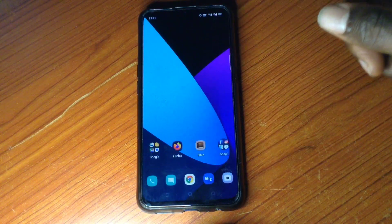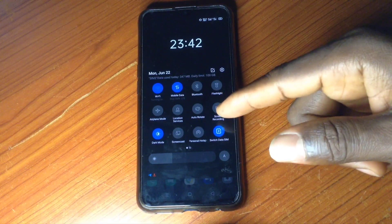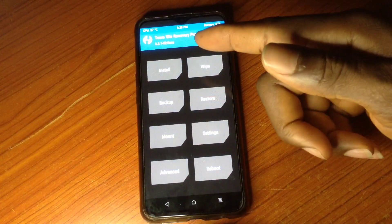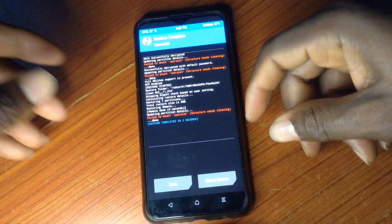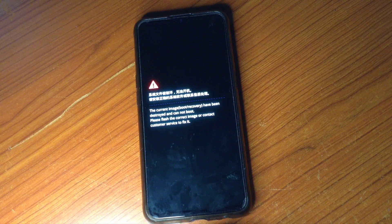As I turned the phone back on after flashing the Ozip, what did I get? I got broken sensors, a hotspot not working, Wi-Fi not working, even mobile data disconnecting and reconnecting. I tried getting another persist since I flashed my own — it didn't work. I got another persist from another developer — it got worse. Now the persist partition wouldn't mount, and when I went further, I met the screen of death. This is where most people just want to give up and say their phone has bricked. But there's a way to force it back.